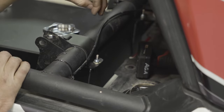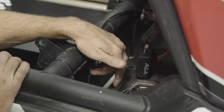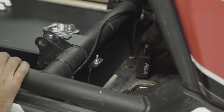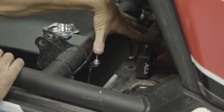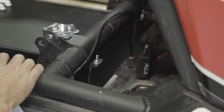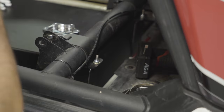Those four are tight. One quick note: the bar clamps may not come into physical contact with the strap — that's okay, there are some variations between chassis. Just make sure you are evenly tight on both sides. If you fully tighten the two on one side you can actually pivot the tank down where that side hangs lower in the chassis. So as you're tightening, work your way back and forth so you suck the tank up evenly.